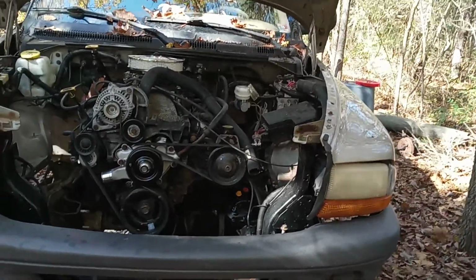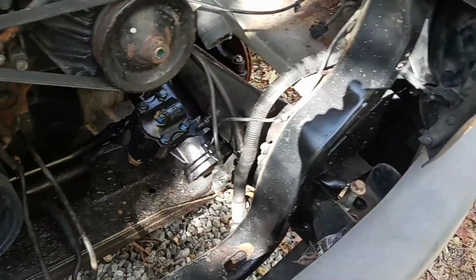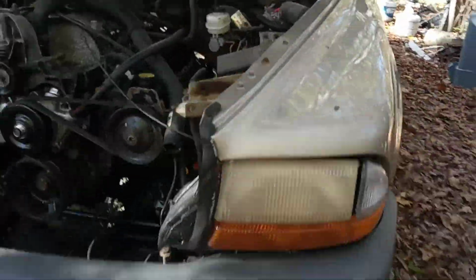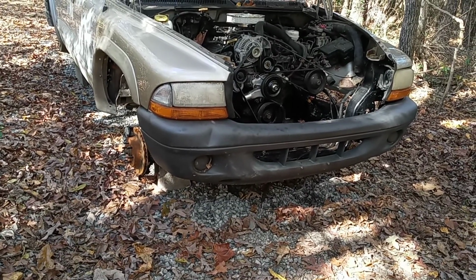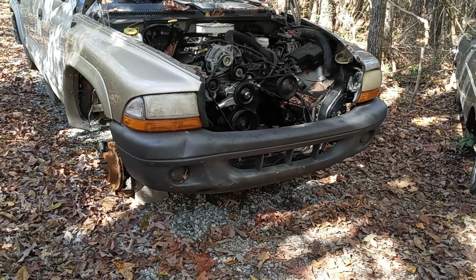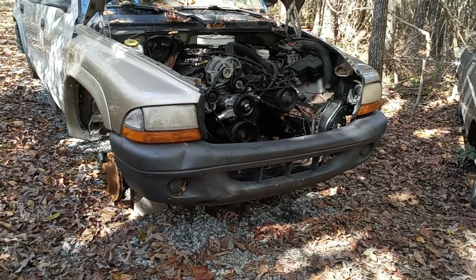So anyway, I'm gonna check this idler arm out here, make sure it's gonna bolt up like it's supposed to, and then get that bolted up, and then we'll have to pull our steering box back off so I can install our pitman arm, and then our steering will be wrapped up for the most part. I'll have to set the alignment, just kind of get it roughly set. So I'll turn the wheel straight, and I'll take a tape measure, and we'll get it as close as we can and put our wheels back on. I'm gonna get it lined up either way.